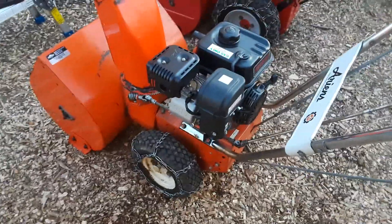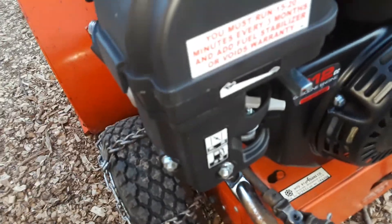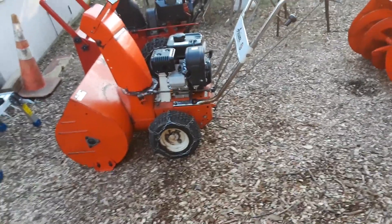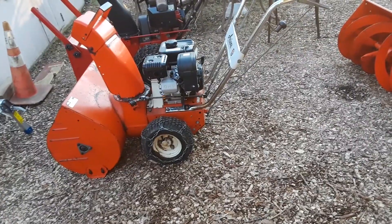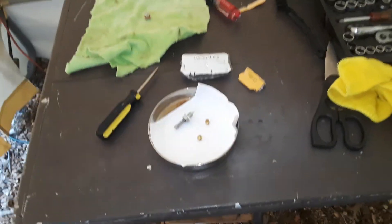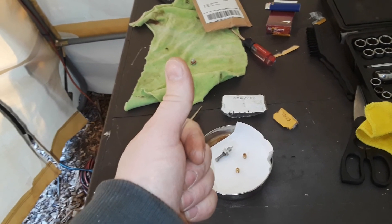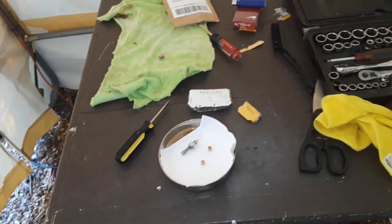You put it under a load and it smooths out. There's the proof — that was no choke, ran perfectly smooth. Anything under 4000, and at 4400 it still wound a little bit, but as soon as I put a load on it, it smoothed right out. These adjustable main jets are perfect, easy to install, easy to adjust, and I highly recommend them. I'll leave a link in the description to where you can buy these. If this helped you with your Predator, give me the thumbs up, smash that like button, rate, comment and subscribe. Later Tubes!